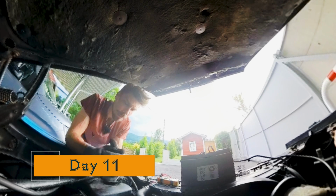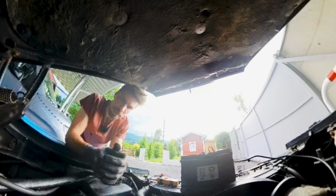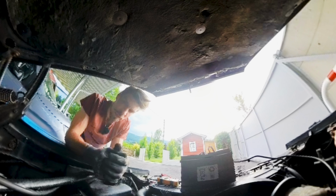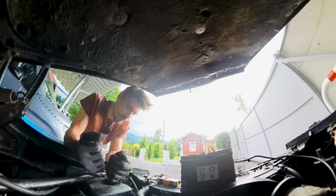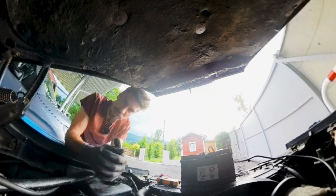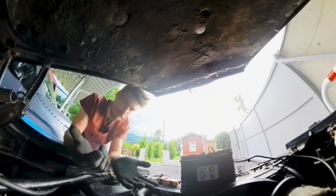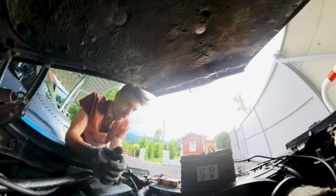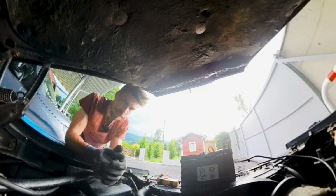I'm constantly thinking about what else could draw this much voltage or amps from a battery while the car just sits here. And I kept thinking that maybe my magnetic relay is drawing voltage when it is switched on, because the coil obviously needs voltage to keep the contacts closed. So I thought that this could be the reason. While I was welding with my battery 2 days earlier and almost burned the cables to the starter down in here, I thought maybe I want to try this out.